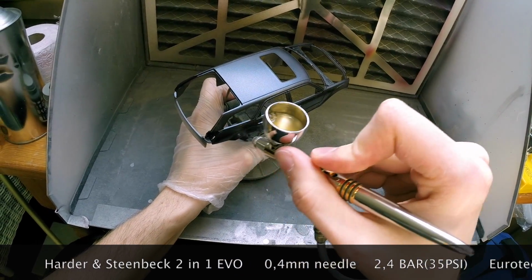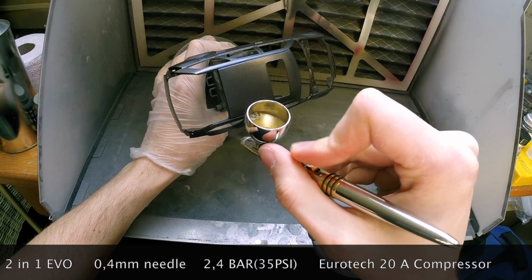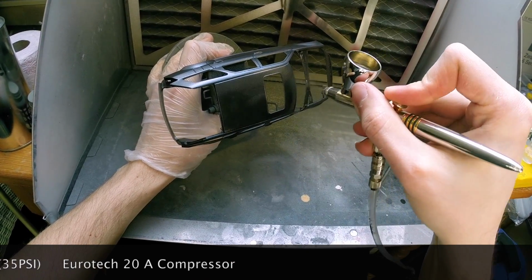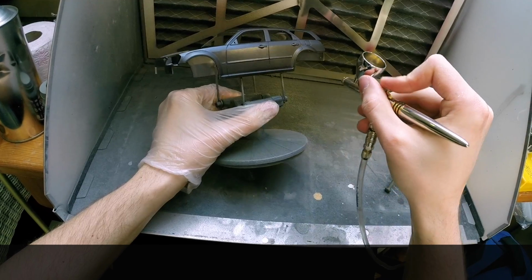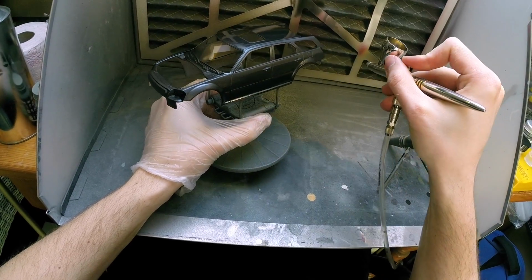Now these flat clear coats are a bit more prone to the tiger striping than any of the gloss clears will. The gloss clear coat just usually gets hit out and you don't see a thing, but for these flat clear coats they need to be pretty much perfect, otherwise everything will show. Now all the dust was removed.